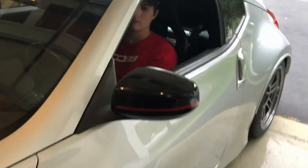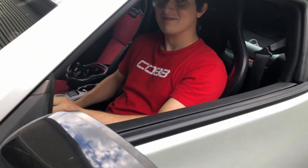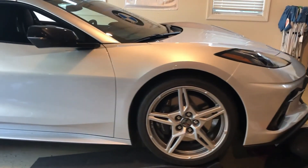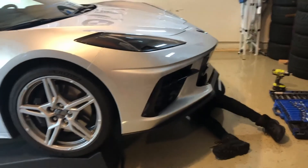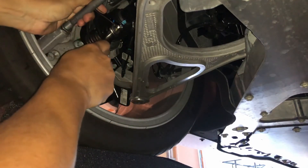I need to get your Z out of the garage so we can start working on the car. Alright, first we got to get the Z out of here — move this pile of rice, dude, we got real stuff to do. Alright, so now that the Vette's up on ramps, the first step is going to be to take out the end links, so that when we get started with the initial balancing process there's not going to be any sway bar preload and we're going to reduce any binding. So we're going to go ahead and take the rear sway bar end link out — we already got the front.